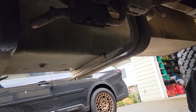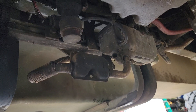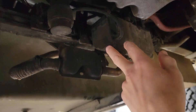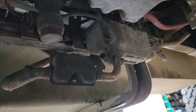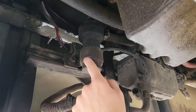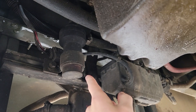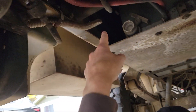Here's the Eberspacher. If you go back in the build series, I basically reverse engineered this unit out of a Sprinter to work with an independent ECU that you can buy separately, but I'm not going to get into that. This is the coolant pump right here, which came off a Webasto kit, and the pump is controlled by the Eberspacher ECU as well as the signal that goes up into the shelter to turn the fan on on the radiator.